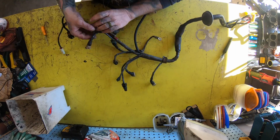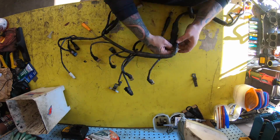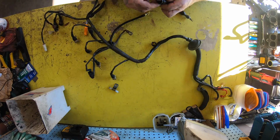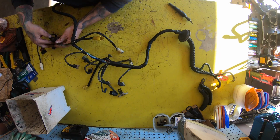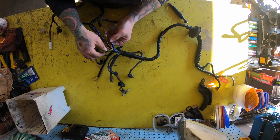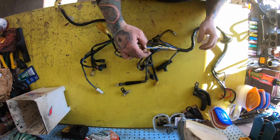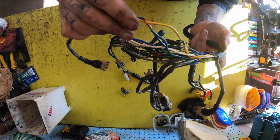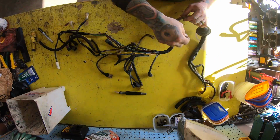Toyota wiring harnesses were notorious on the 22RE for open crimp connectors in the wiring harness. On the 12-volt power side coming from the resistor box, there were 2 open crimps. They just had some tape wrapped around them, but these were known to corrode, and sometimes the wires would fall off. There's those crimps. A solution is to cut those crimps out, solder and heat shrink everything.